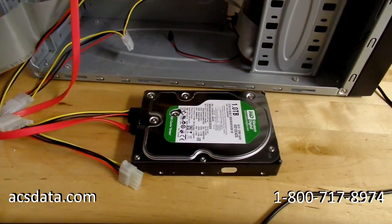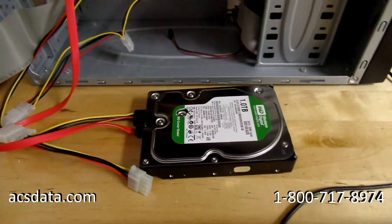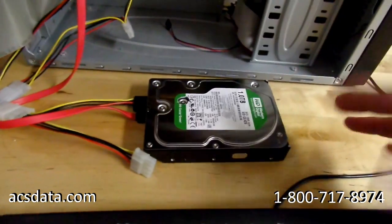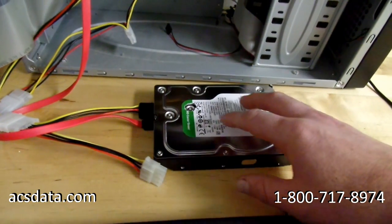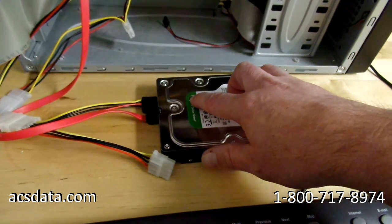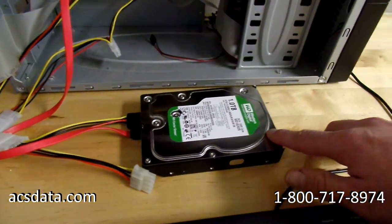We've already gone through and done an initial step, which is essentially to regain the head alignment. What we typically do is we can either access some settings in the firmware itself, and allow it to compensate for some misalignment that way. But sometimes it's just fine-tuning the case cover itself. We may loosen the case cover up some, and make slight adjustments back and forth, up and down, just until the center point of the head stack assembly is hitting the top of the case cover just where it needs to, so that it gains the track alignment that it needs over the platter surface.